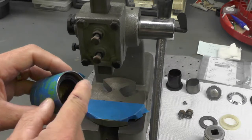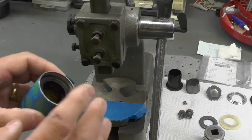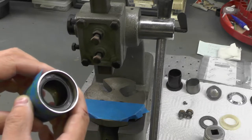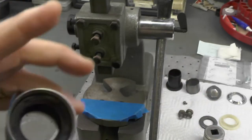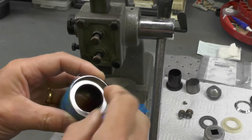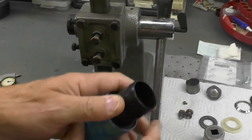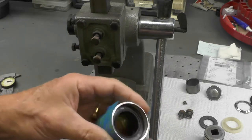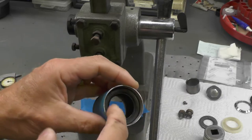This space here between the top of the seal and the top of the nut should be approximately 7 millimeters — I'm going to check that right now. If it's not exactly 7 millimeters I'm not going to sweat it; it felt like it seated just right, but I'll check to be sure. It's just a fuzz over 7 millimeters, so that seal is in place. Now ultimately what will go on top of this will be this large washer, and then this spring guide fits like that — this is for the exposed external springs of the fork itself. That nut's done, so let's go ahead and do the left side fork while I've got the setup together.